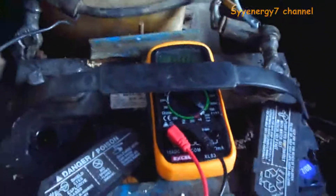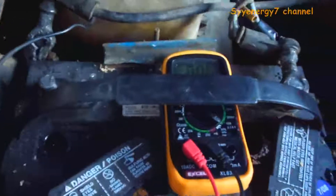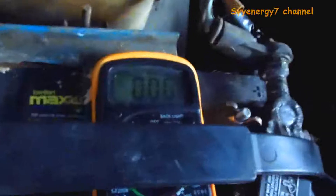Just to show you what I mean, I'll turn the headlights on. They're not going to come on until I make the battery connect with the ground. You can see what kind of amperage it's drawing. I flip the headlight switch on, so I've got to make the battery ground out to make the lights work, and we'll see what kind of draw the headlights are pulling.